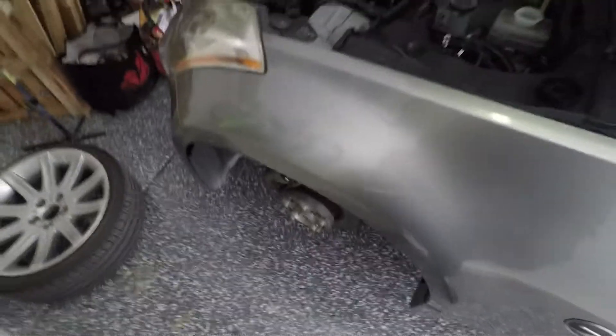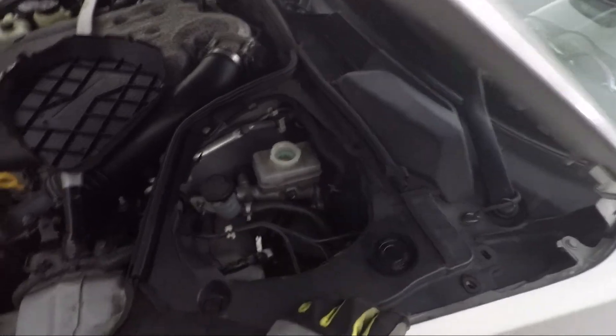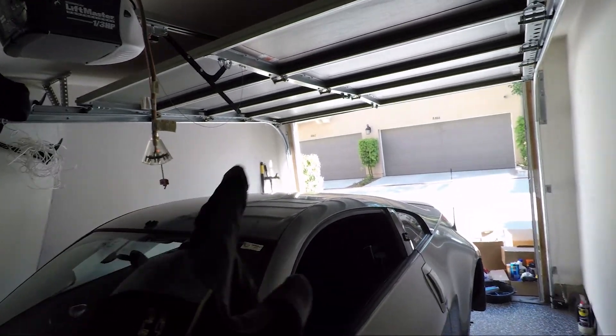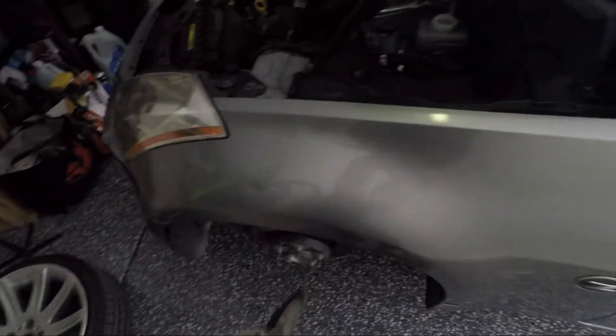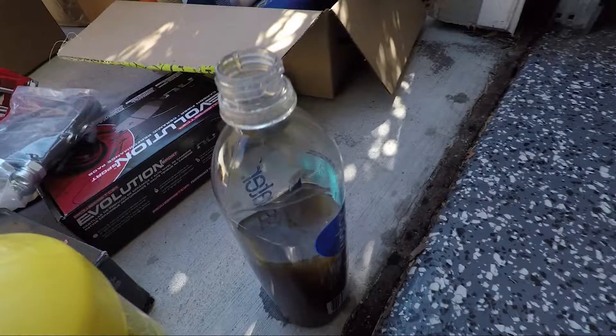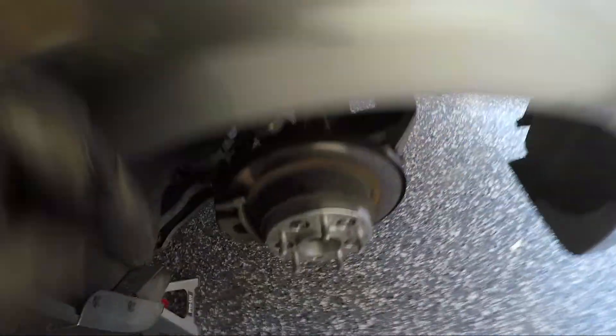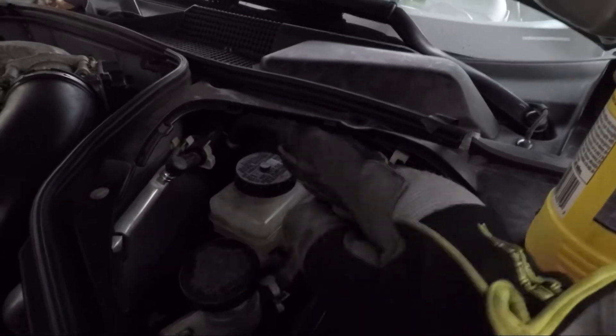Because I didn't want any old brake fluid in my new calipers, I'm gonna flush the brake system before installing the big brake kit. I already jacked up the car and took the wheels off. I'm gonna put the new brake fluid in and flush all four calipers, starting from the passenger side rear, then the driver rear, then the passenger side front, and then the driver front — because we want to start from the farthest corner from the master brake cylinder.